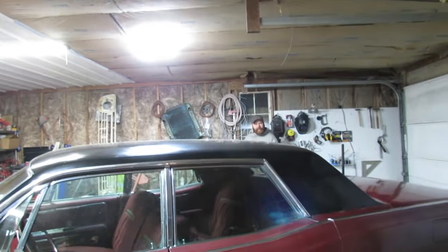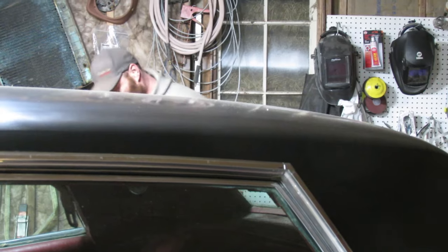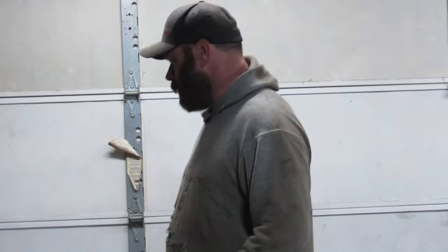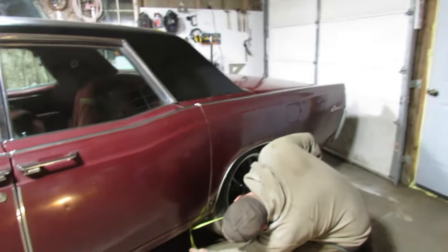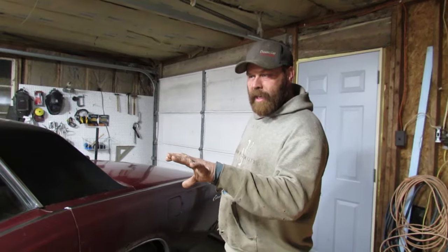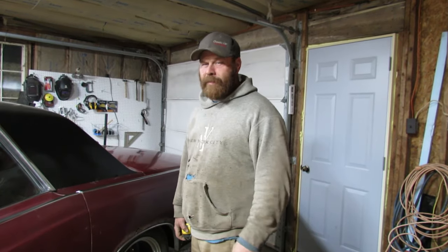The front one up. Back end of that car used to sit really high. The other car, I don't know. One way to tell, I measured the rockers the other day. What are they, 8.5? I measured something today with the damn measure. Oh, yeah. That's 1.5 inches higher. Perfect. Now it won't rub. With it sitting that low, I think it would change the pinion angle and I'd get a vibration at like 115, it'd start vibrating. Sure. Kilometers.